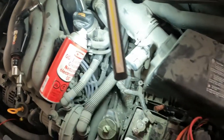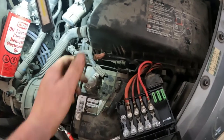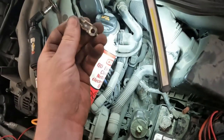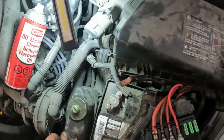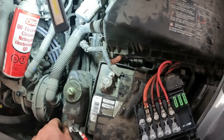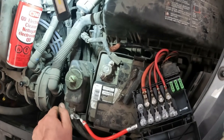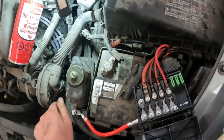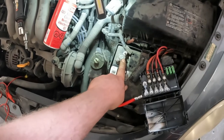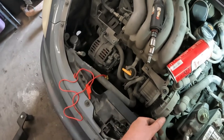I know it was working pretty quickly before. When we dug into a spot right here where the actual copper was past the terminal, I got a half-volt voltage drop — that is a lot. For something that's only flowing tens of amps, you don't want anything really measurable. Maybe even 100 millivolts is kind of a lot. About 100 millivolts is what you'd expect between the positive battery post and the post directly on the alternator at just about full output.